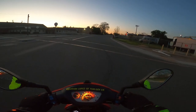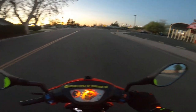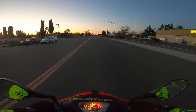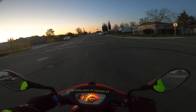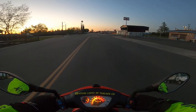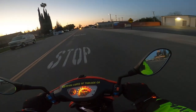For anybody dealing with their scooter — my scooter didn't come restricted. What I mean by restricted is sometimes these scooters have a restriction to limit your top speed. You can tell because when you're full throttle it cuts out and gets back in — that's your restrictor. I'm not very knowledgeable on bypassing it besides buying a CDI box with no rev limiter to bypass the restriction. There are different ways to go about it — just Google it and you'll find YouTube videos showing how to do it for your specific model.